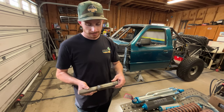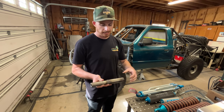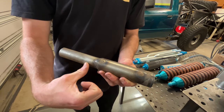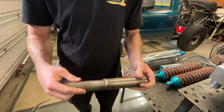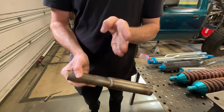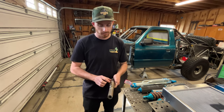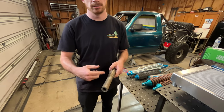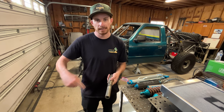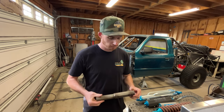The bung slides into the inch and a half sleeve so everything is butted together on the inside. The bung meets up perfectly against the inch and a quarter 250 wall tubing, and then the sleeve goes over the top. There are rosette welds tying those two pieces together, plus four plug welds. Where the two meet, I do a notch rather than a straight cut, because a straight cut creates a shear point. You always want to add some sort of shape to it — a notch is typically the most convenient way and it also looks really good.